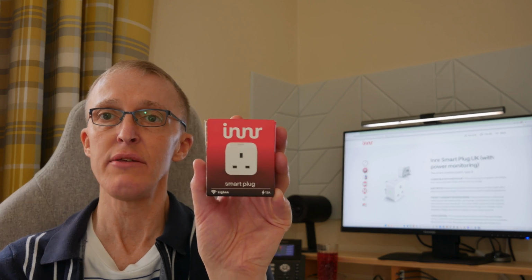Do you want to automatically charge up your Home Assistant kiosk? Well, in this video I'm going to be showing you how to use the Innr Zigbee Smart Plug in Home Assistant and create some automations so that it automatically charges up our Home Assistant kiosk, and in this case it's a Samsung Tablet A7 model. What we'll be doing is creating some automation rules in Home Assistant so that it automatically charges up the tablet when the battery drops to 20%, and then it will stop charging when the battery reaches 80%. So let's get to it now.